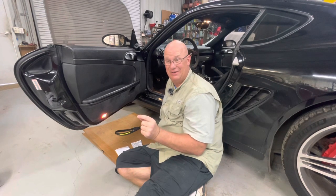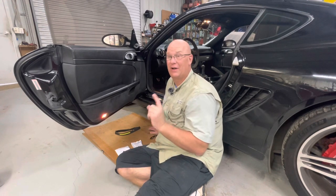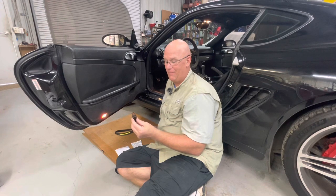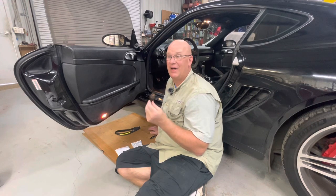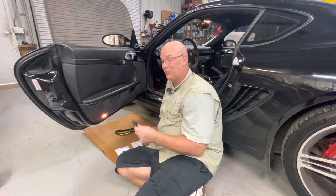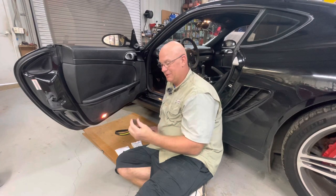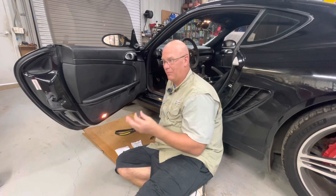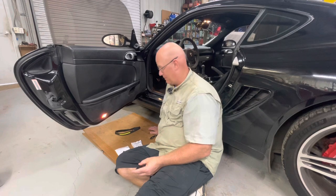Swapping the clutch switch narrowed the range from between 38-42 down to between 39-41 on that same road spot, but it still cut out. So I swapped the brake switch too, and now it does not cut out four out of five times down the road — it still does it once at 40 mph. That's been four trips since then. Total was $53 worth of parts plus shipping.